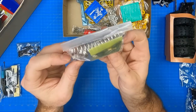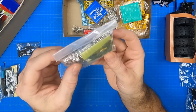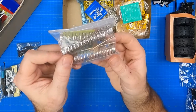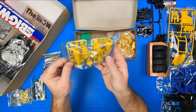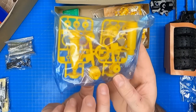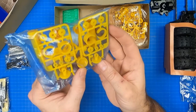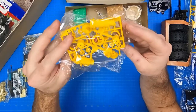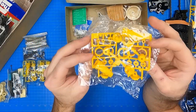The damper bag contains everything damper. Short front and long rear springs, front and rear piston rods, four 6mm spacers, 12 O-rings, and four damper oil seal diaphragms. The long rear dampers come on two J-parts trees with two T-parts trees. This includes the damper cylinder and top and bottom caps. The T-tree has the bushings, diffusers, and connector end. Likewise, the short front dampers come on two Y-parts trees with two X-parts trees. They come with the exact same parts, just laid out differently on the parts tree.